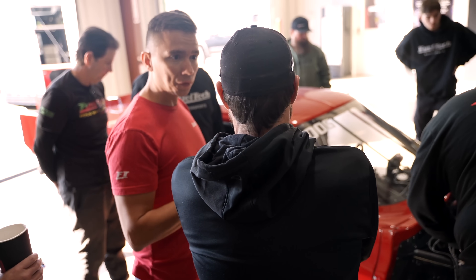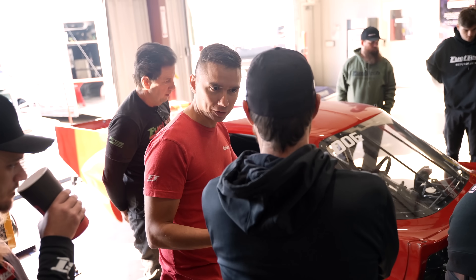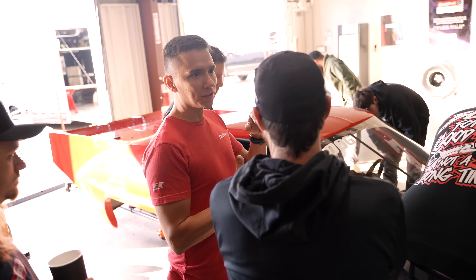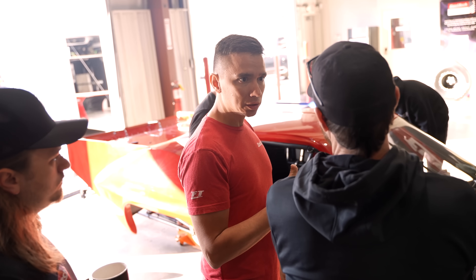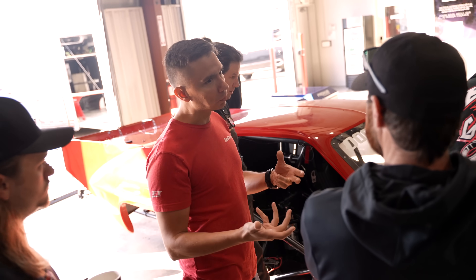I'm about 50-50 for duty cycle, so I'm using half of the injectors. I almost could run four and four, right? That's what I'm saying. But the deal — when you have 50, the same top and bottom, it's easier to understand the splits. It happened before — we were at the track with a guy and one injector got clogged, died. We just increased the other ones. We ran seven. So we have some room to play with.